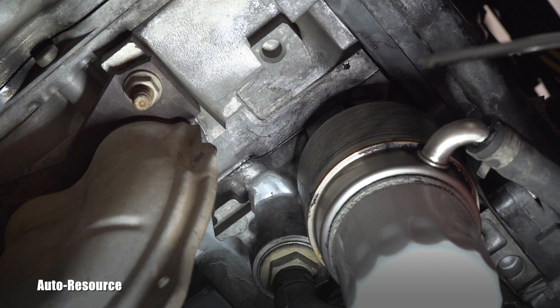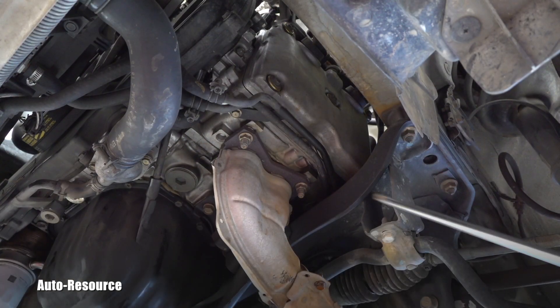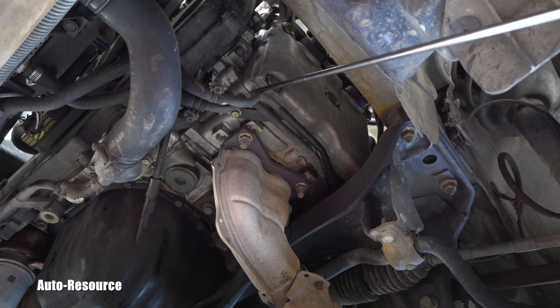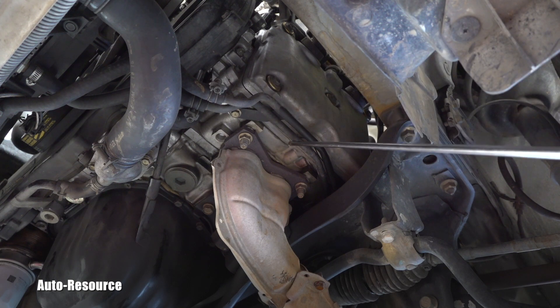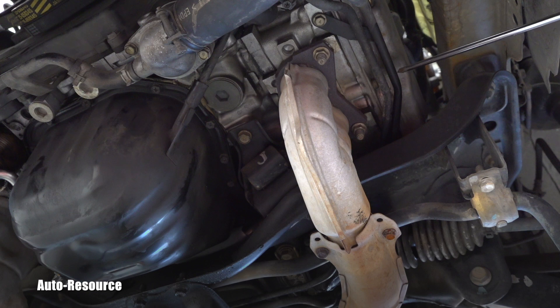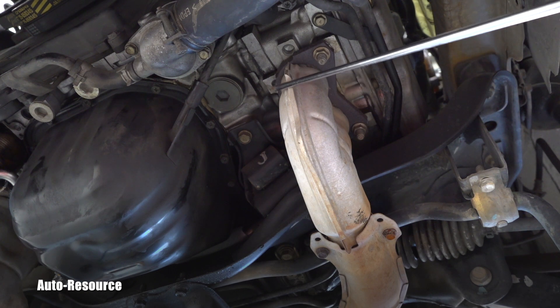You can see that head gasket sticking out just slightly on this side. If we look all the way in, as we did in the beginning, this passenger side is perfectly clean and there's nothing wrong. However, it's not the same on the other side. Moving to the driver side — you can see the valve cover and the gasket line; it's pretty clean with no leaks, minimal engine oil or almost none.